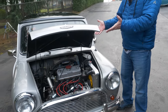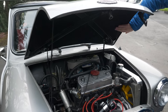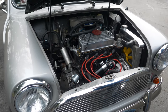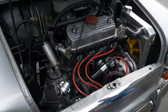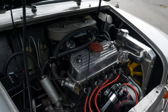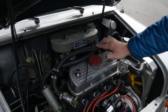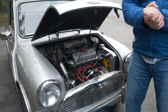We're at the front of the car with the bonnet open. We did do a bonnet soundproofing kit in here and that really does make a difference — it makes things so much more comfortable inside. What we have here is a 1275 Austin America motor with a smog port cylinder head that's been reworked, ported with big valves. We've got a shiny mini-fin alloy valve cover, twin inch-and-a-quarter SU carburetors with the factory Cooper's air cleaners, which are incredibly sought after and expensive these days.